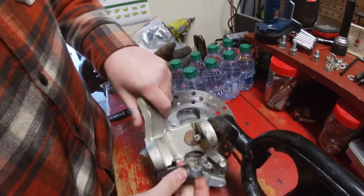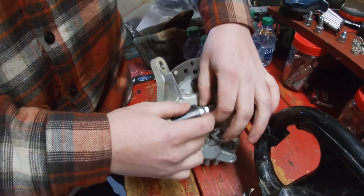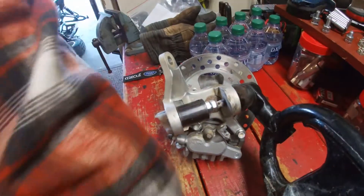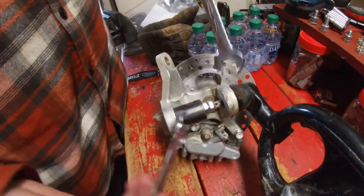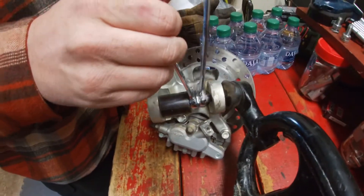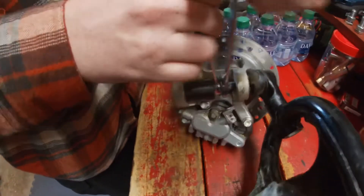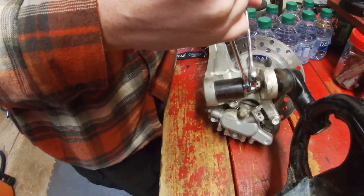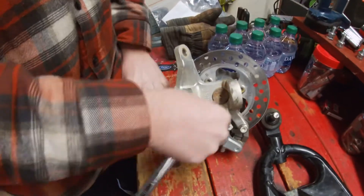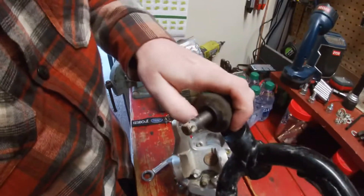What you're doing is loosening the bolt out of the nut — it's an 11/16th drive. You take two wrenches and slowly tighten one and loosen until that ball joint pops out. We're not reusing these, so it's okay if it damages the thread — just like that. If you are reusing them, put a rag on top so you don't damage the threads, though it didn't really do much to it.